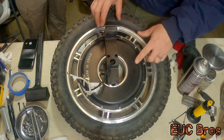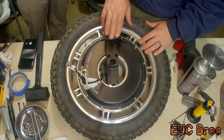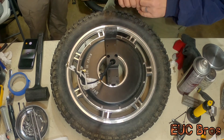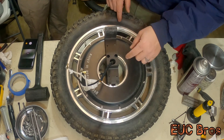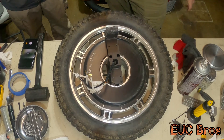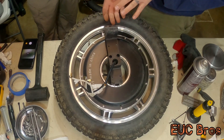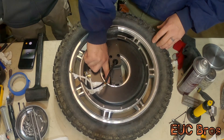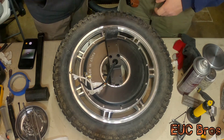Because of the way this motor's made, if you were to run the wires out through the other hangers and flip your motor around, your hall sensor would be backwards. So basically the motor would spin the wrong direction from what Gotway thought it was going to do, and it will blow up. And you can't just switch some motor wires and get it right, because the hall sensor will still be reversed. So just right on the actual hub somewhere, mark it — wires this side. On the inside of the hub you'll see that the hall sensor is on the far side from where the wires come out. So you can always tell, but later when the covers are on you won't be able to see it. So right now, while the wires are out, put an arrow pointing up and mark wires this side.